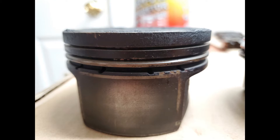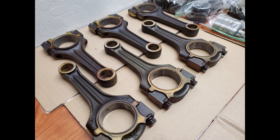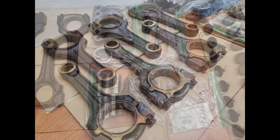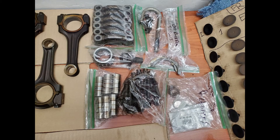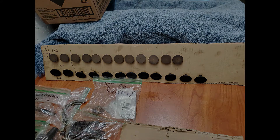Here is the carbon on the side of the piston — you can see it's inside of the ring grooves, just crammed all over the place. You can also see that the side skirt coating is worn off as well. Here's a good shot of the connecting rods and you can see the bearings are still inside of them, so you can see what they look like from both sides. Here are all the parts up close and here are the valves. With all that out of the way, let's jump right in and clean everything.